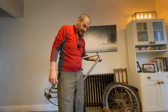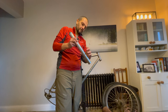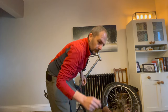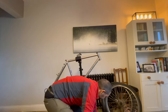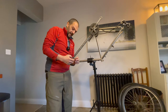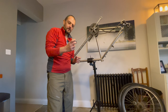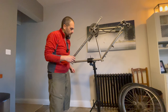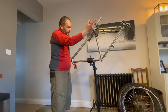For knocking the pressed cups out there is a special tool — I can't find mine, but it splays out at the bottom, expands inside, and knocks the cups out. I'm going to use the screwdriver method instead. I'll flip the frame and do both sides. Both cups are out now — it didn't do any damage. But if I were keeping these I wouldn't be hitting them with a hammer and screwdriver; I'm just going to replace the headset anyway. The frame is then ready.